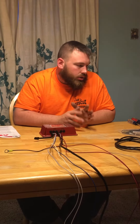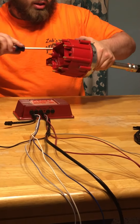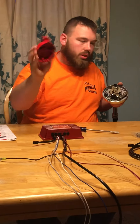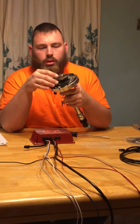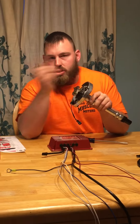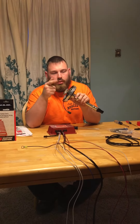I'm going to give you a quick rundown on setting this up because it looks daunting, but per the manual it's really quite simple. To take your cap off on these HEI distributors, there are little push-down lock L-clip latches. Use a flathead — flatheads work best. Push them down, twist them loose and they come off. Take the rotor off and you've got your mechanical advance mechanism. Always make sure it's free-flowing. You can also buy spring kits at auto parts stores. Tighter springs slow the timing curve for stock applications; softer springs open up faster for higher-revving performance applications.